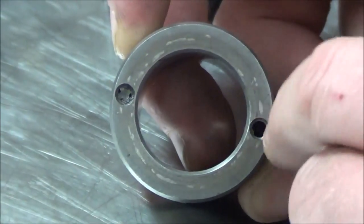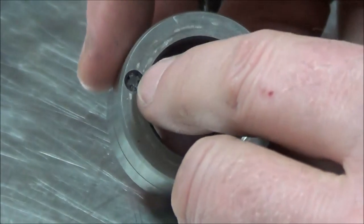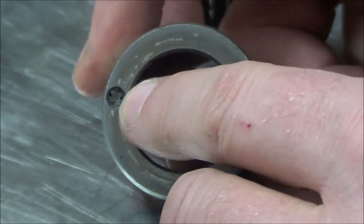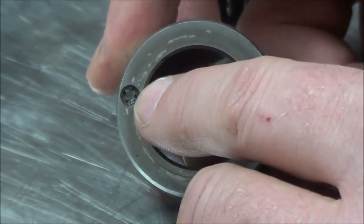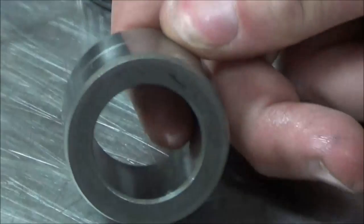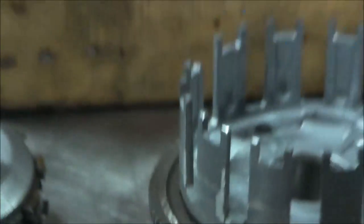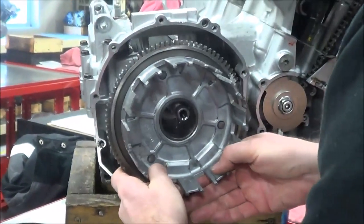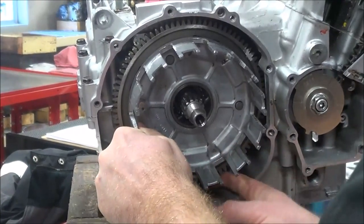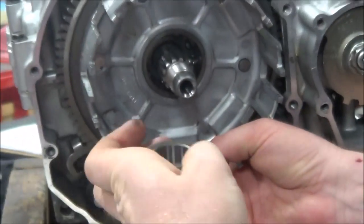Not a good day. Taps are pretty fragile. I'd probably go get the right little five millimeter bolt instead. If you break a tap in there, you'll sit and mess around with it quite a bit. So I'm going to go up and insert this - you guys are going to be doing assembly lube on all your shafts. I'm going to reach underneath and try to get that gear to engage. It is engaged on the clutch basket.